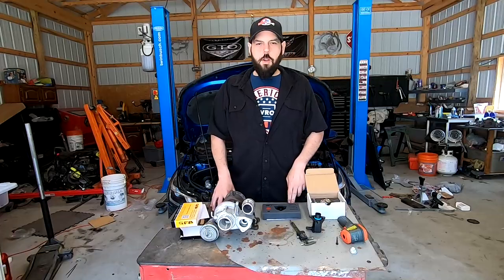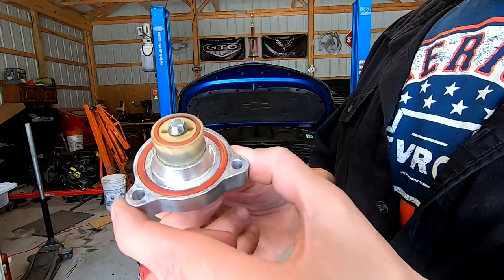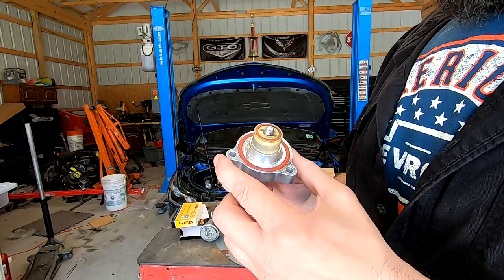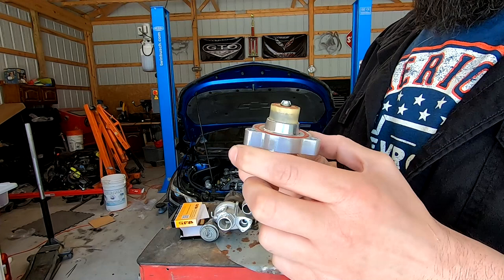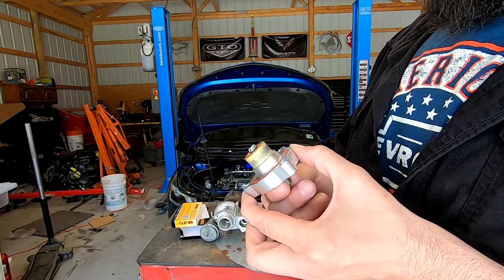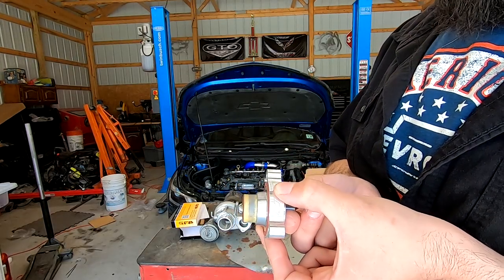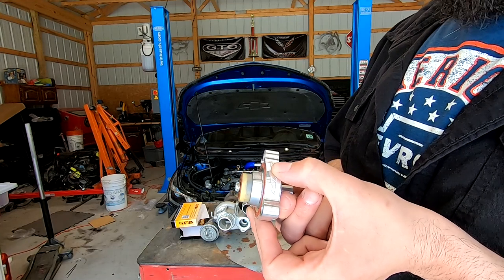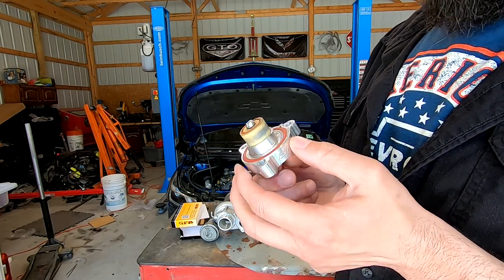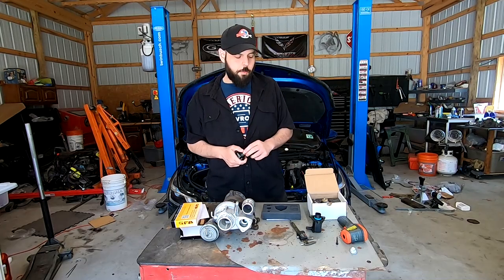Here's the Bad News Racing HPRV. This is designed to go in and when it needs to relieve pressure it will open, relieve the pressure, then close — great design. When you're running a big turbo, this will hold a lot of pressure. I myself run about 30 psi and this holds the pressure well. The problem is when this starts to limit the boost pressure to about 5 psi while driving, that's what gives you that screeching noise. Any diverter valve designed like this will do that.